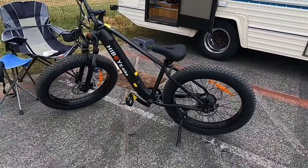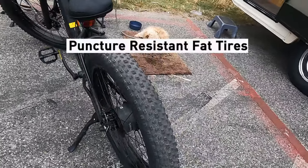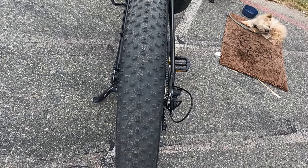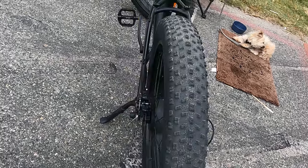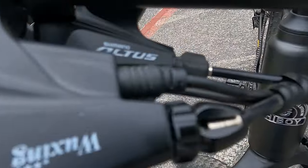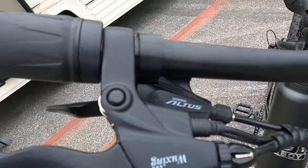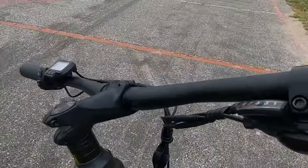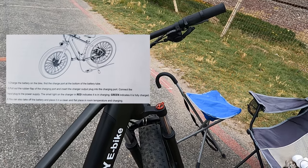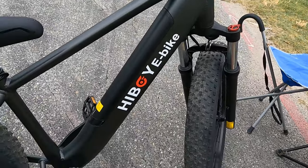If you're pure electric pulling down on the throttle, you're talking about around 24 to 25 miles range. It's got big old tires — I took it on the sand already and it moves really good. It's a pneumatic 26-inch tire, with disc brakes. The drivetrain is Shimano Altus nine-speed — the first nine-speed I've reviewed. The charger is AC 100-240 volt input, DC 54.6 volt output. Frame material is aluminum alloy.